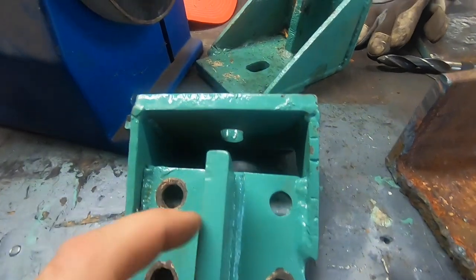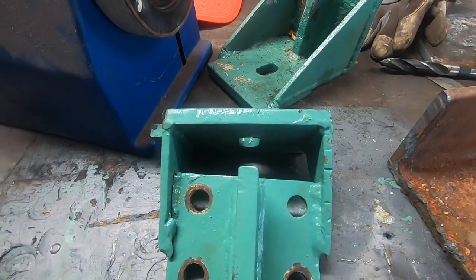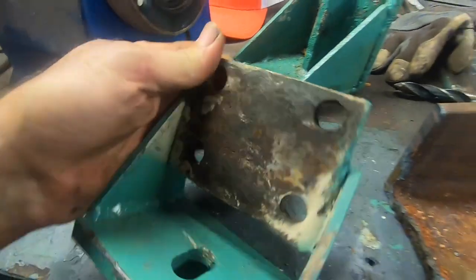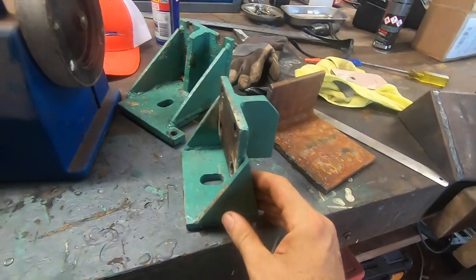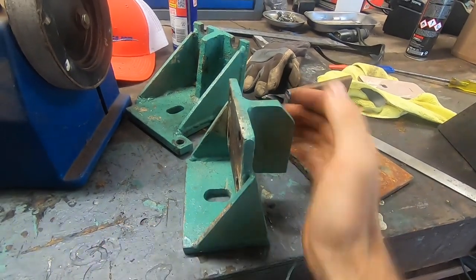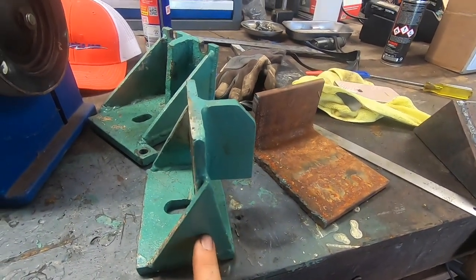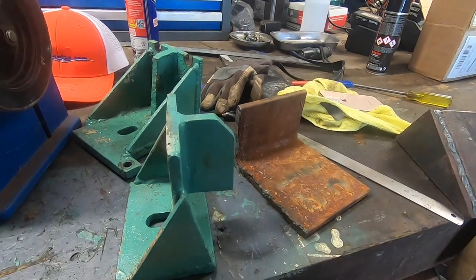I certainly have no worries about this being strong enough given this is welded all the way front and back. This is actually one of the original mounts I'm replacing - it's got a little bit of a booger weld here and absolutely nothing on the backside, and that's lasted 30 years, so that gives me confidence. This engine mount is a slightly funny one in that the flange comes down off the block then actually goes in under the gearbox. So there's no way I can lift it up 40mm - I'd just hit the gearbox. The plan is to come down here and then out to the right - that was actually Adrian's suggestion, he's always got lots of good ideas.